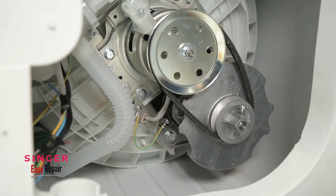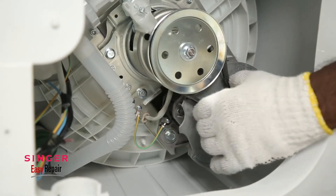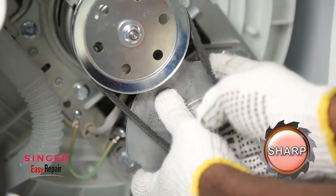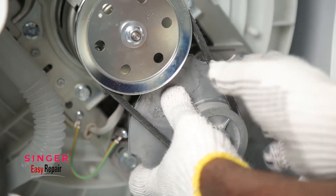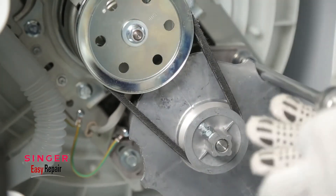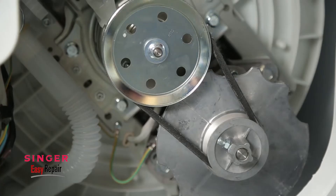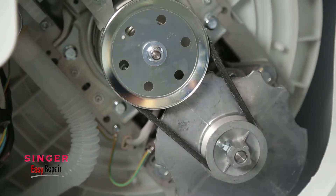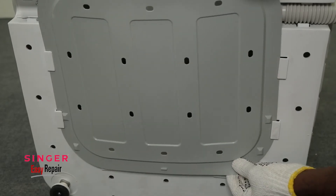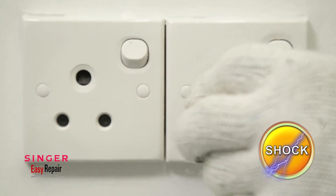You will feel that the belt is quite loose and easy to push in. Remember, this is exactly like tightening a loosened belt in a working washing machine. Now lower the bottom unit enough to tighten the belt and screw it in. It should feel taut to your hand. If it's tight enough, reattach the rat guard. Then supply the power and check the functionality of the washing machine.